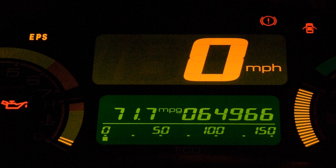Many modern speedometers are electronic. In designs derived from earlier eddy current models, a rotation sensor mounted in the transmission delivers a series of electronic pulses whose frequency corresponds to the rotational speed of the drive shaft, and therefore the vehicle's speed, assuming the wheels have full traction. The sensor is typically a set of one or more magnets mounted on the output shaft or differential crown wheel, or a toothed metal disc positioned between a magnet and a magnetic field sensor.